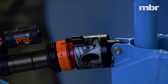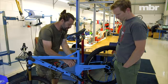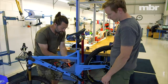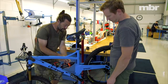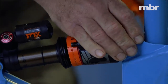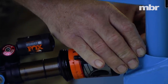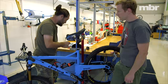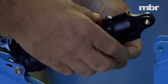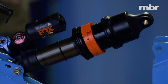James has already jammed it full. You're probably going to have to take out that spacer limiter. This acts as a volume spacer in itself, but it's wider than a normal volume spacer so it stops customers from putting too much in. There's a maximum number of spacers allowed, but that's based on maximum pressure — if you were 90 kilos riding downhill courses already at maximum pressure everywhere else, that might be an issue.